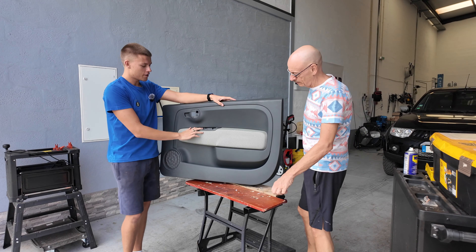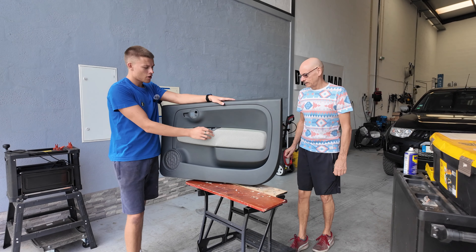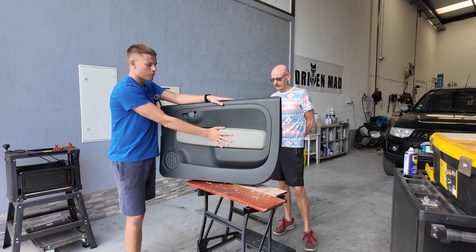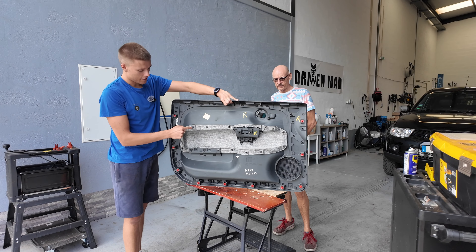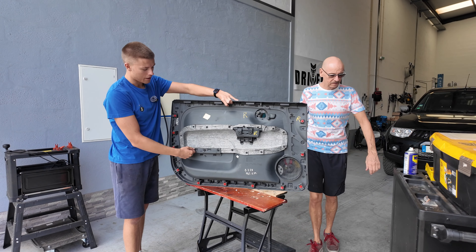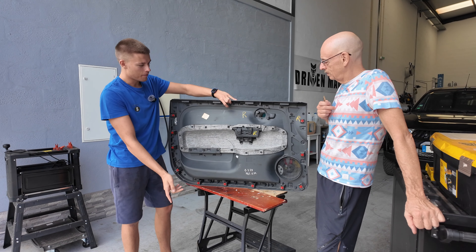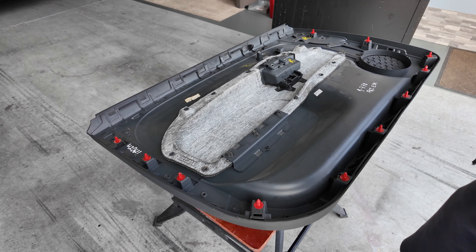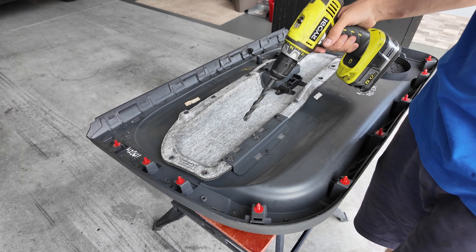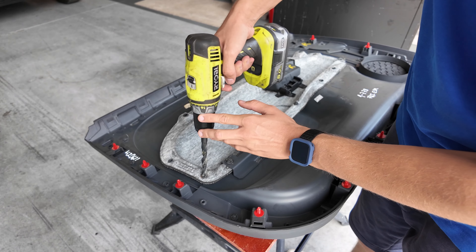So my door card does have the red insert but it's all grey. I've been looking around the internet for a long time and I cannot find a red leather piece black door card for less than 500 quid, and I refuse to pay that. So I've decided to do it myself. I bought this door card from a scrapyard for 40 euros and we're going to try and take out this fabric piece which from behind is held in with all these plastic melted screws. We're going to drill them out, take this out, then clean up the door, prep it and paint it black. My weapon of choice is a big drill bit.